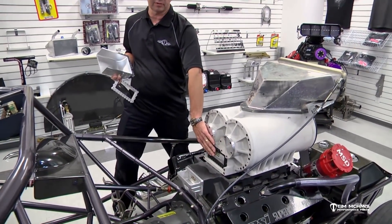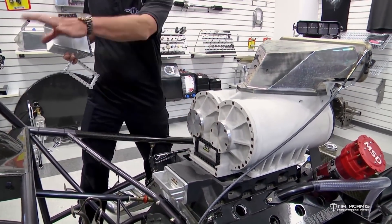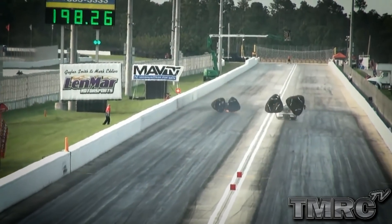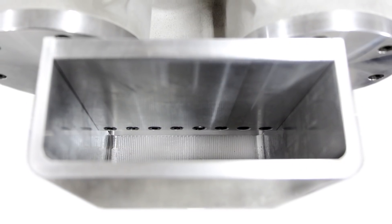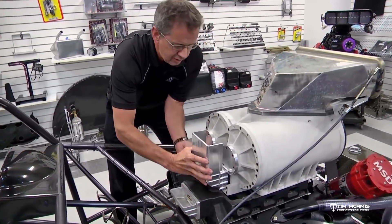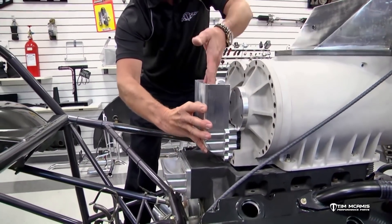The screw charger cars were very popular back then and the burst panel on those was on the back side of the supercharger itself. It faced the firewall and windshield, and when these things went sideways and the engine tune-up was off, that burst panel came out. It would literally blow the firewall and the windshield completely out of the car and back in on the driver. So what we did was we turned all that energy up into a little chimney — an aluminum part that bolted on over the burst panel and raised it up through the hood. When the panel let go, it would take that pressure and heat and fire and instead of blowing it back on the driver, it would turn it up and exhaust it straight up out of the hood.